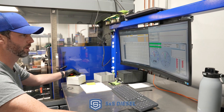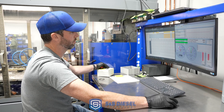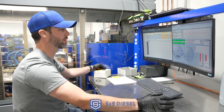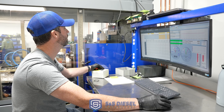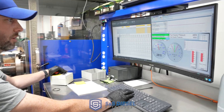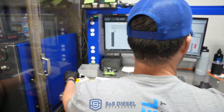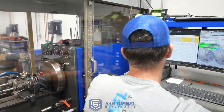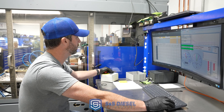So it's a good sign so far, but we always run a variety of speeds, variety of pressures, and different IMV or FCA milliamps — basically sweeping it through all kinds of different conditions to make sure that in all truck operating conditions it'll be healthy. This next point is a lower pressure point, so comparing high pressure versus low pressure we can check the health of the valves as well as the actual bore, pistons, and all that. The high pressure is definitely more abusive, obviously.